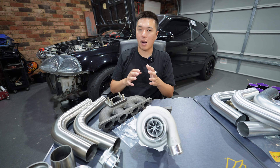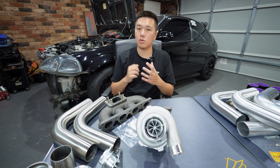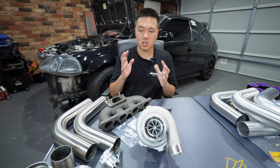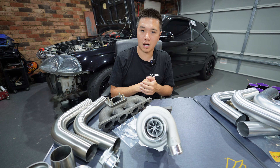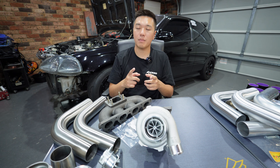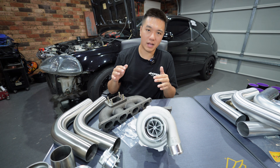At the moment I think this engine is not very happy — I believe the head has lifted. But we're going to fix that with a turbo kit. The goal is to pick up power everywhere in the power band because the D16 Y4 is quite underpowered for the chassis, so we can afford to go for a quick spooling turbo which shouldn't unsettle the car in the corners. This is still the stock D16 Y4 and I don't have any plans to build the motor anytime soon.